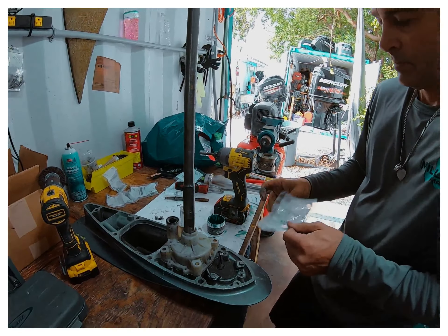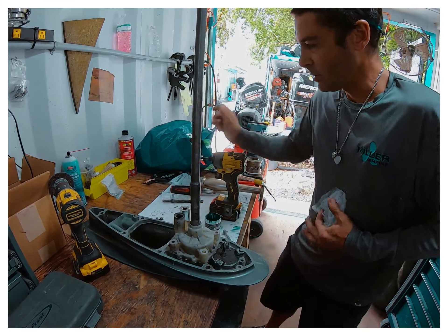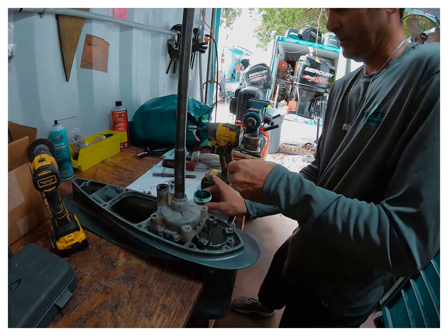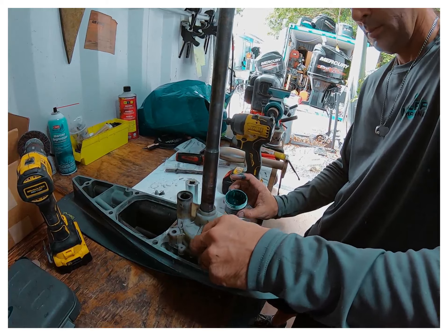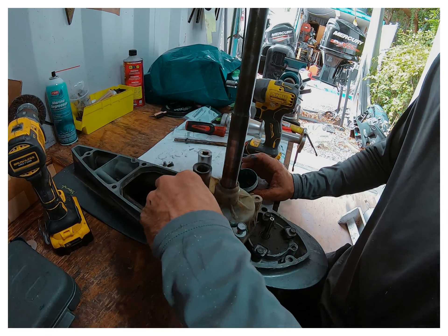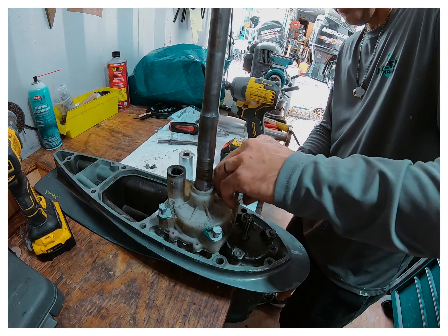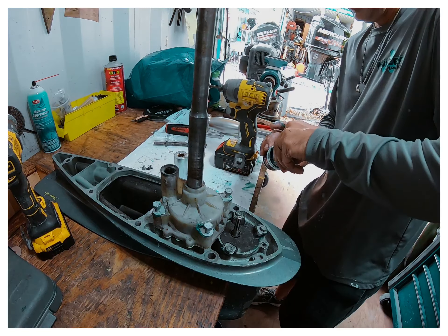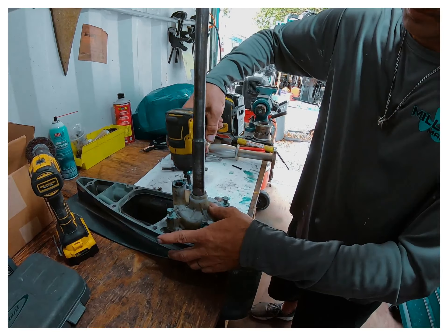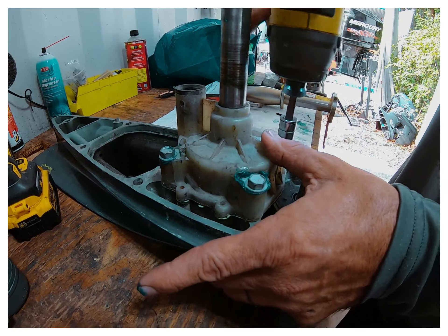Take our new hardware out of the bags. Put a little grease on them. Start them so you know they're not cockeyed or anything. Always push down these tabs — if you take your gun when you go to secure them down, they'll flip around and tear the little indent that they go in. And tighten them up. There you go.